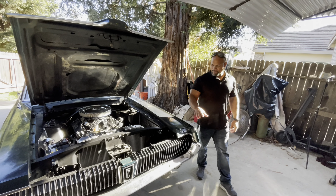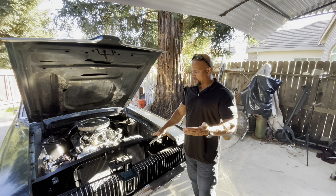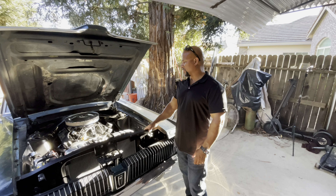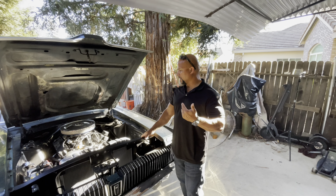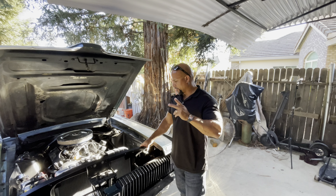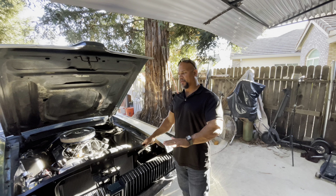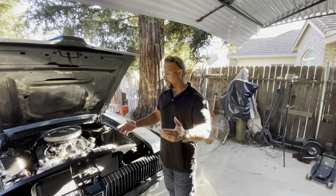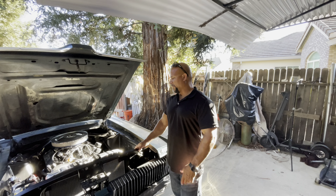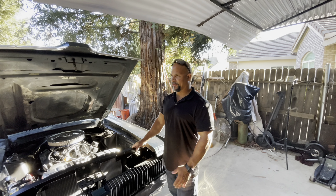The Cougar was almost complete. We took it out for a test drive - we thought we had the timing in the ballpark at 41 degrees, which is a ton. We put some bigger squirters in and did some ancillary things to make it run better, but the customer went for a test drive, the car was about 130-140, he stabbed it and it coughed a little bit. It's either lean because it's cold, or it needs a little more timing - though that doesn't make sense at 41 degrees for a small block Ford, which should be maybe 36 or so.